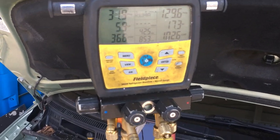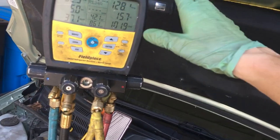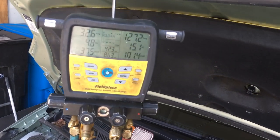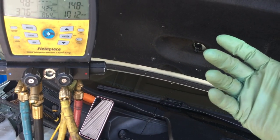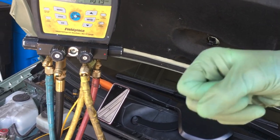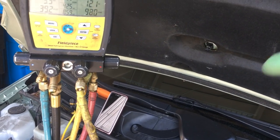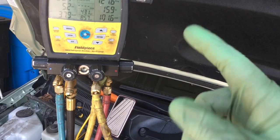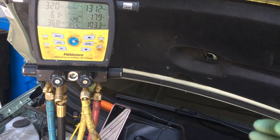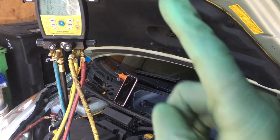It has reached that point right now. I see guys on forums saying they're getting 24 degrees out of their dash, 28 degrees, 30 degrees — and they're either using uncalibrated tools or infrared cameras pointed down the dash, which distorts the lens and gives a falsely cold reading. But if it was actually that cold, especially for guys in Florida, Louisiana, or high-humidity areas with 60–80% humidity...